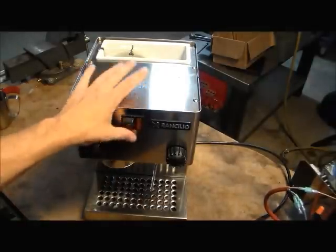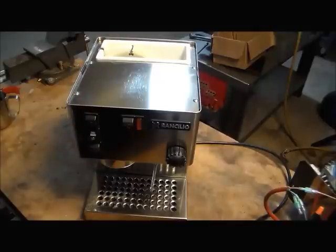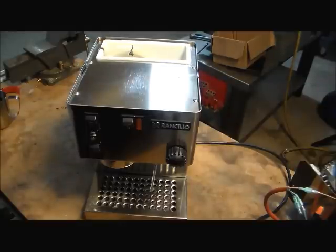I am suspecting that the reason why the client was having that very loud electrical sound when you first turned it on is the heating element is popped, and it is literally electrocuting the water to boil it. And that is verified by me not being able to turn the unit on with the GFI outlet. So we are going to go ahead and take this unit apart and see what we find.